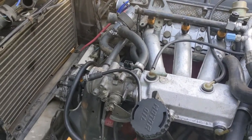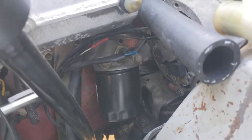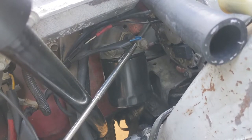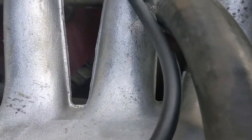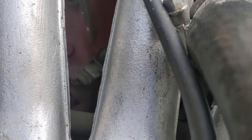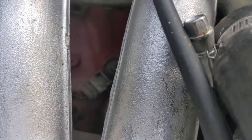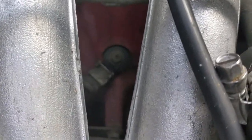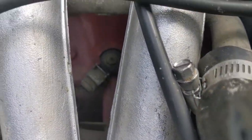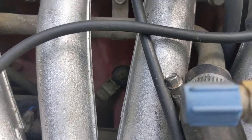While I'm over here, I'm going to do the next few things: disconnect some more electrical. I have to disconnect the alternator excite wire down here, the oil pressure sensor right there, and the knock sensor which is under here. This is one of those AMP TE Power Timer connectors with a little clasp to let it out, so you've got to be careful — it's hard to get your hand under there between those intake runners. If you have big hands, get someone with smaller hands to do it. I also need to disconnect the crank sensor electrical — this is a non-turbo with a crank sensor.